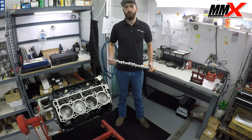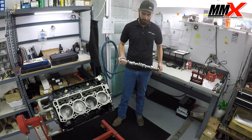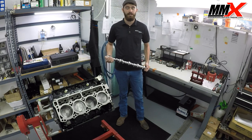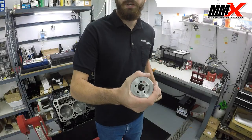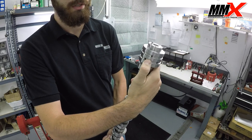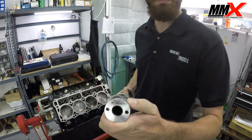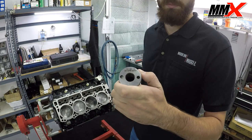I'll go over a few things that typically go wrong on installation. The first step you're going to want to do is clean your camshaft. The way they come out of the box, they are not ready to be installed in your engine — you definitely need to clean them first. Inspect your camshaft bolt hole for debris, look down in the VVT passages and make sure there are no debris in those passages. One thing new we've noticed is the new core from Comp is gun drilled, and you'll want to make sure there are no debris in the gun drilling portion of the camshaft as well.